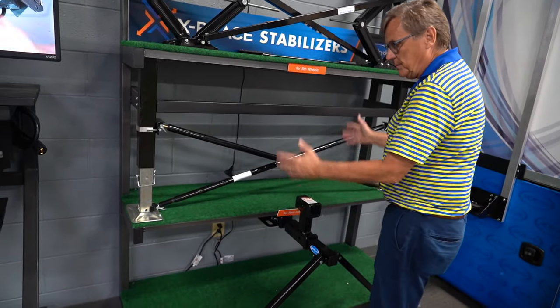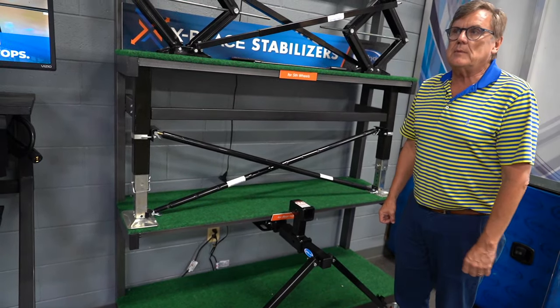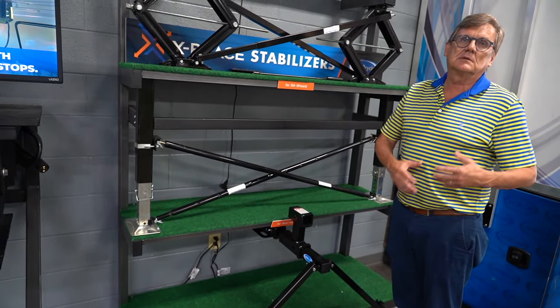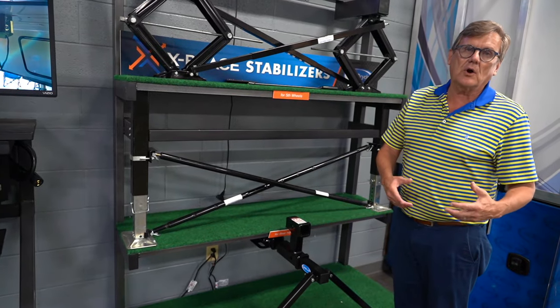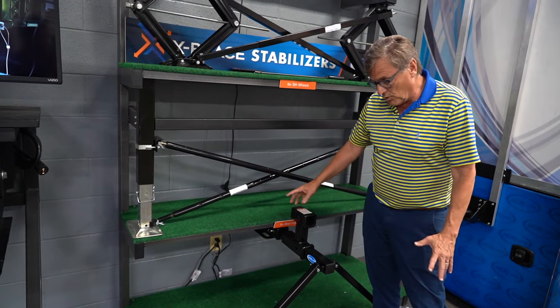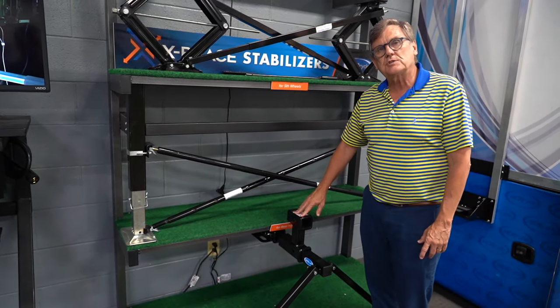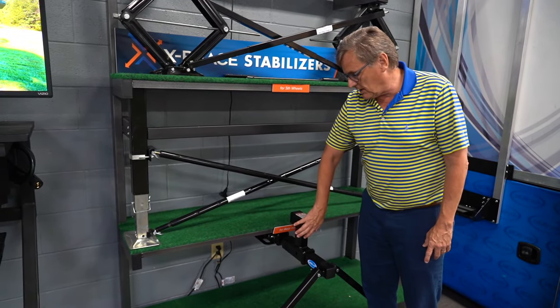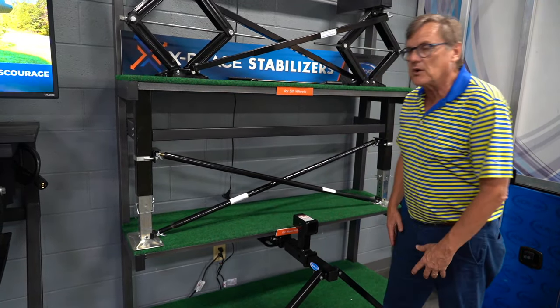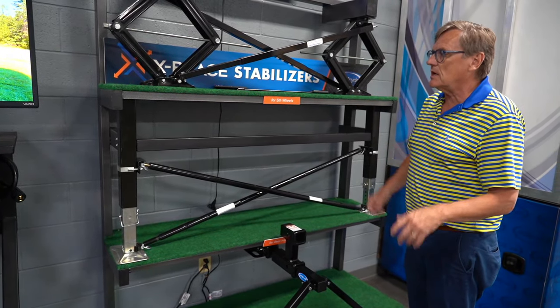It can be stored in the up position, or it can be taken out and put in storage. But some people came to us and said, okay, what about bike racks? What about cargo? I don't want to take this in and out. So there's an aftermarket solution. MORryde does not manufacture this, but you can get it online: a dual hitch receiver. Now you can store your bike rack here and the X-brace down here and get the maximum improvement from the X-brace and get rid of that side-to-side unwanted movement.